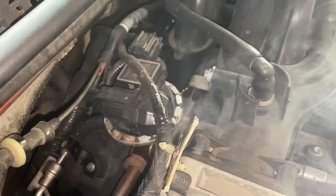A few moments later — I've got the new gasket installed and the engine running, and so far it's running really smooth. Let's look at the fuel trims on the scan tool. Our short-term on bank one is going negative — long-term is at 12 and short-term is at negative six, so the short term is counteracting the long term. We're going through a correction phase and I have not cleared any memory — this is a live update. Bank two long-term is at five percent and short-term is at negative five percent, so we're pretty much zeroed out. I'm going to let it run longer to let the computer do the adjustment, but so far the engine is idling nice and smooth and the fuel trims are showing a correction — exactly what I wanted to see. I'm calling this a fix.